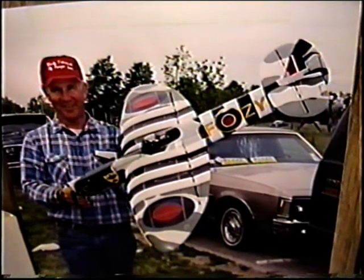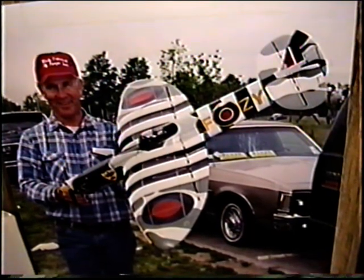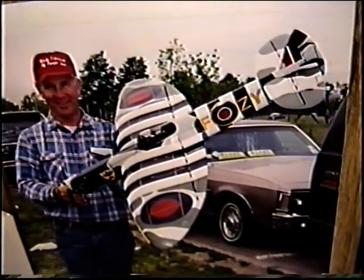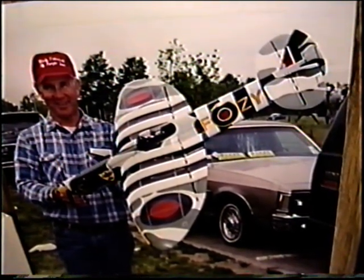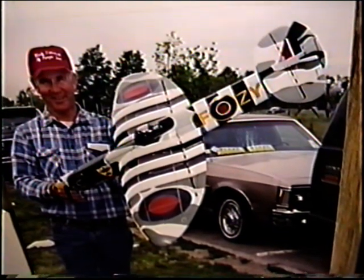About this time I always like to look around the model, make sure there's no little flaws or anything I don't want to bury in the clear. I want to get the first coat on a little thicker — roughly 50% thinner — but never put the first coat of clear on super wet. You run the risk of melting the canopy or the ink lines. You want to get the first couple of coats on dry, meaning roughly 50% thinner.